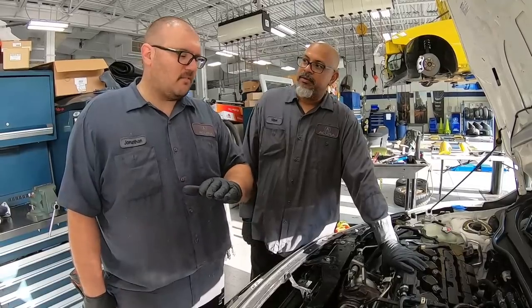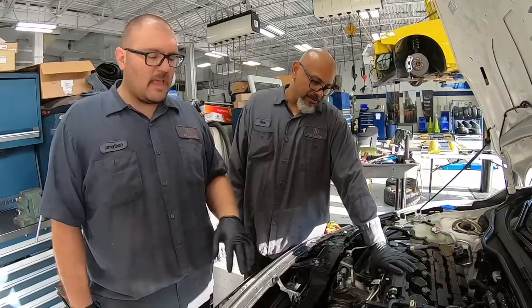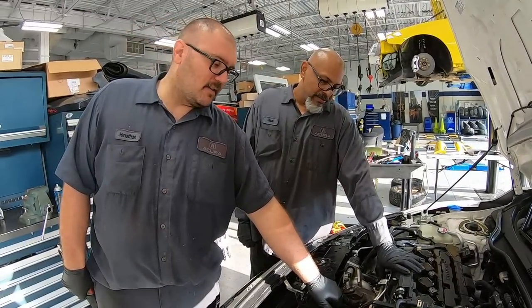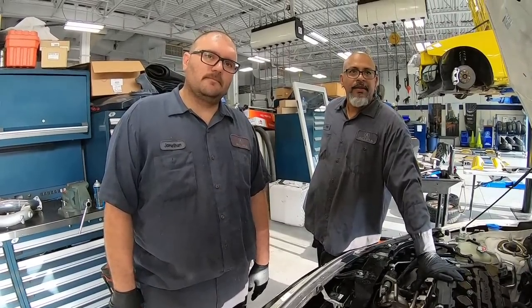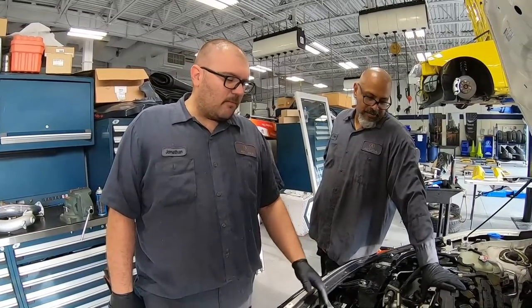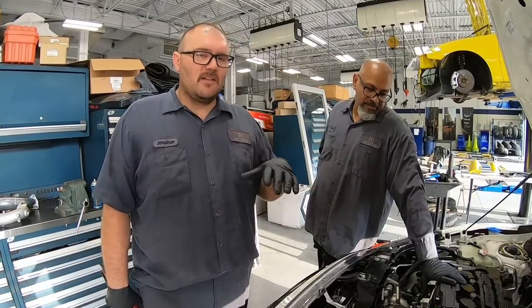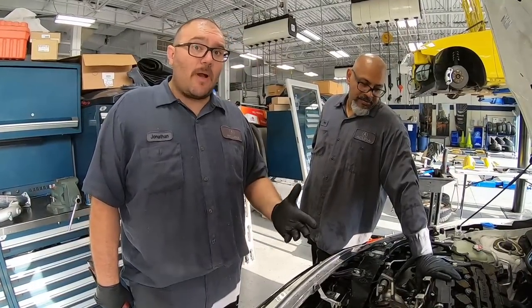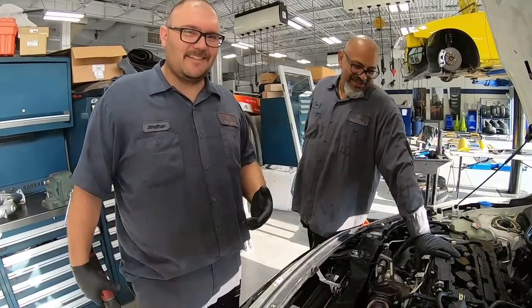And make sure that it's completely cold, because these things really like to bite onto the stud. As mentioned last time, when the car has any type of heat, the stud tends to just break off. It likes to lock up. That's why we recommend at least 4 to 6 hours, maybe even with a fan on it, to let it cool down. Or you could just go at it and snap the studs off, but we're not that bad around here. No butchery.